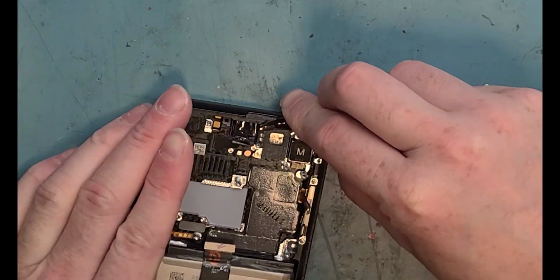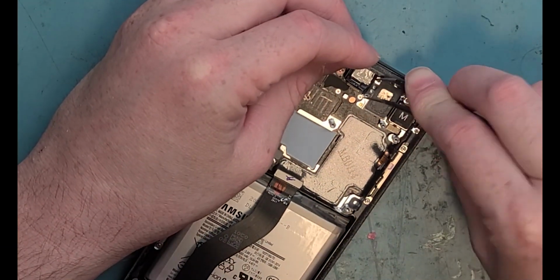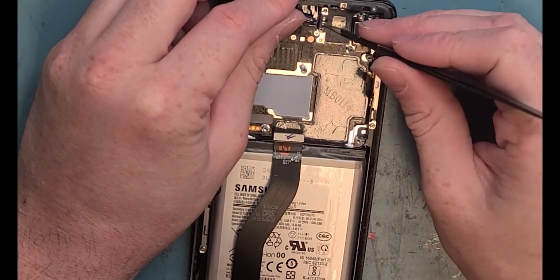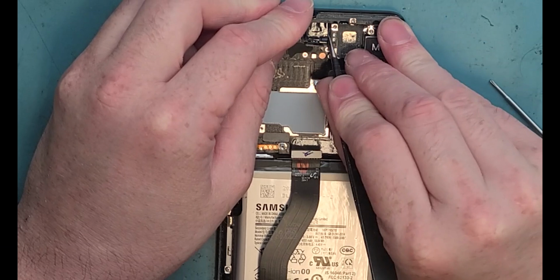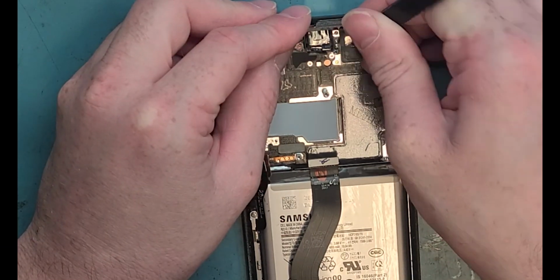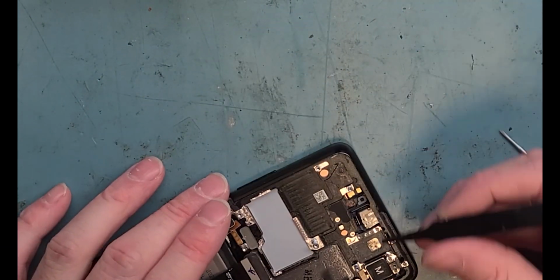This is the front-facing camera connected to Face ID. You want to make sure you don't break it. There's resin around it, so get out some tweezers and then you just want to pick at it and pull out the resin first, and it has a little blue bracket. And I also use some acetone on it, so then it comes out nice and easy, and I'm not pulling on the ribbon cable too hard. You want to make sure you don't break this because it cannot be repaired. It's serialized, connected to the motherboard. It's a big issue if it does break.